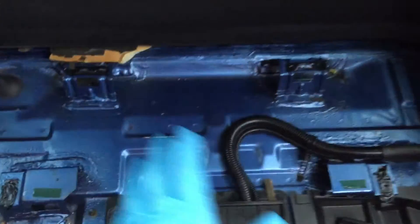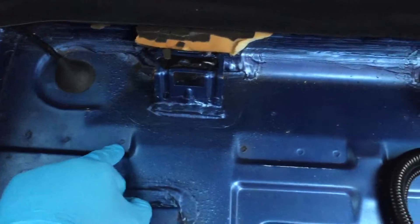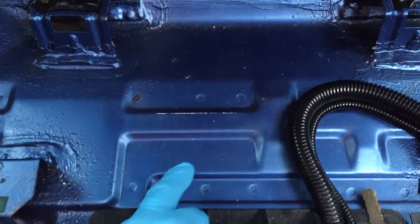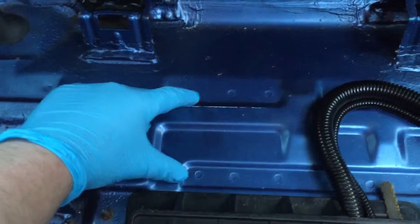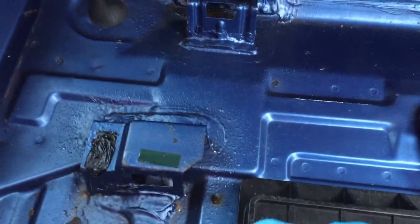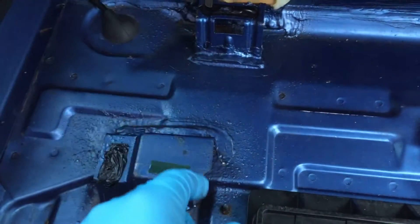This is what you need to take out to inspect the floor. You're looking for spot welds which are circular, around about six millimeters. These spot welds hold panels together, and there's a cross beam underneath the car in this line of spot welds where the differential mount holds on to the car. The torsional load over time tugs at the metal panels and tries to separate the two.